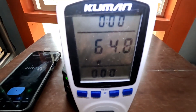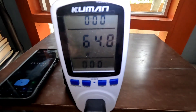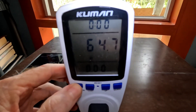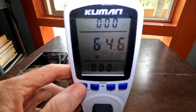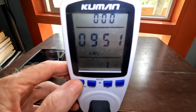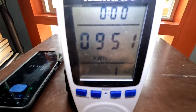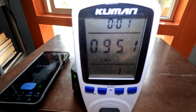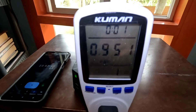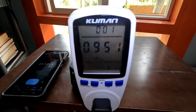It's been running — not constantly, it does cycle — but we've been running it now for 24 hours. Let's see the other functions on this watt meter. Pulling 64 watts, that's just about normal. Ambient temperature about 80 degrees, refrigerator is full, everything's nice and cold. It's pulled so far 0.951 kilowatt hours. At just under 24 hours, that's less than half of its 2,560 watt hour capacity. Very good, very happy with that.